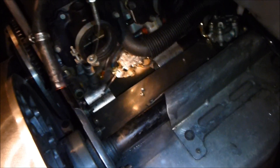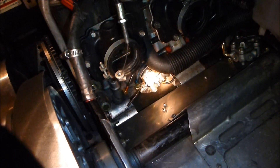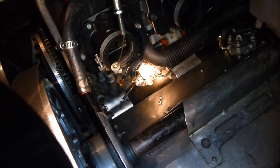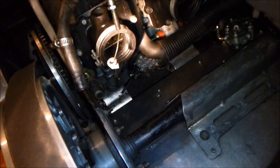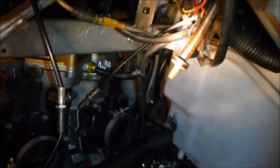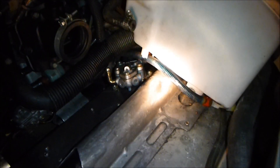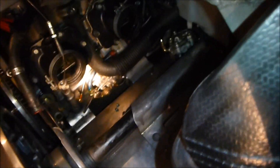Way down there — I don't know if you can see — but that is the oil pump for the oil injection. I always check that little cable down there to make sure it's not fraying. As the sled gets older you've got to start checking coolant lines, fuel lines, and wiring. Give everything a quick once over to see if anything is wearing — like that oil line rubbing on the cover for the jackshaft. You don't want that to spring a leak or it's season over.